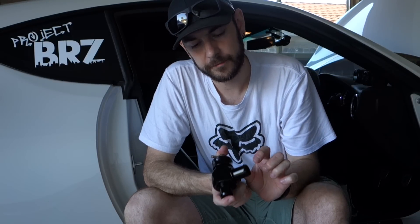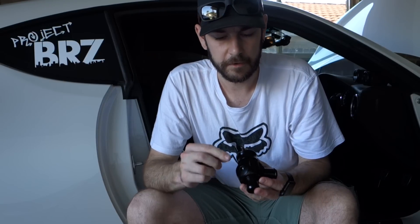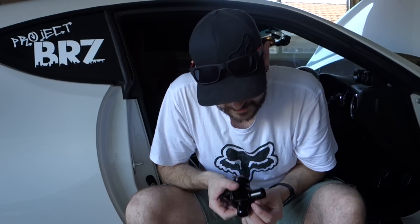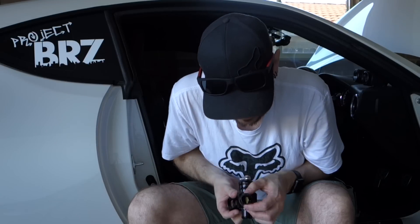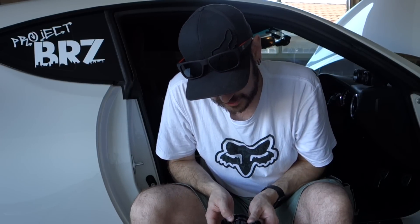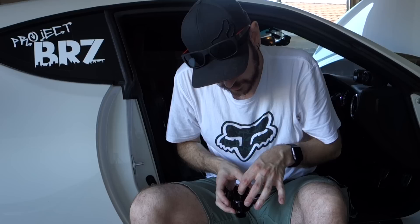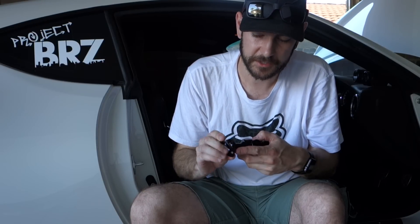Because this is a twin port blow-off valve you've got your plumb-back which vents back to the intake, but then you've also got this plug here which you can remove. At the moment this is configured to be full plumb-back. If I remove that plug and install this little trumpet, that then becomes a dual port blow-off valve venting to atmosphere and plumb-back. What you need to understand is that these two ports are actually slightly offset - the plumb-back sits lower on the cylinder than the atmospheric one does. When the valve opens, most of the air comes out of the plumb-back, and then if the pressure is great enough to push the cylinder all the way to the top, a little bit of the air is vented atmospherically. That trumpet is actually designed with little whistles in there to tune the sound to make it sound really nice.